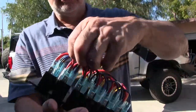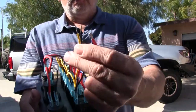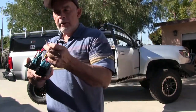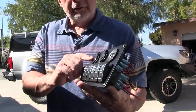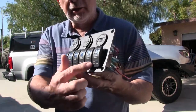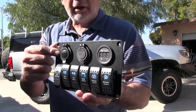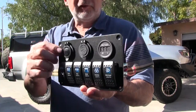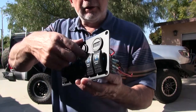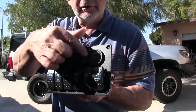Everything's wired, very easily wireable. But you want to wire this to something connected with your ignition if you want these activated when your engine's on, because then the pilot light will light up. I want these to work when the engine's off and on, but preferably when it's off — so if I need to charge something without the motor running, I can turn this on. Because these pilot lights will light up, you don't want those on all the time, you don't need the voltage meter on all the time.